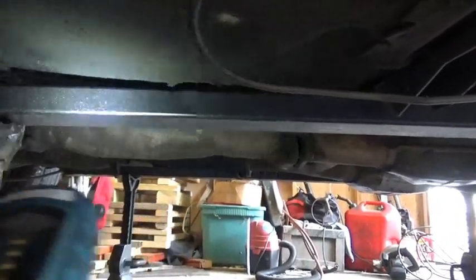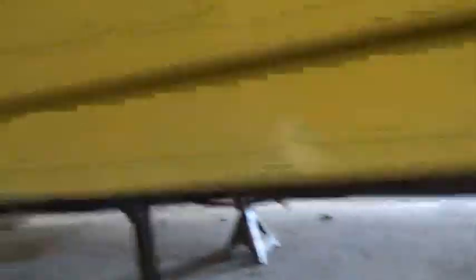So the real question is: did I actually weld my car twisted? No. When I put it back down on the ground, the door gaps were the exact same. If I had twisted it, wouldn't the gap have opened up? Right now isn't the best time to show you since it's on four jack stands, but when we lifted it we made sure all four corners were as far out near the wheels as possible. We put spacers under two of them to make sure everything came up straight.